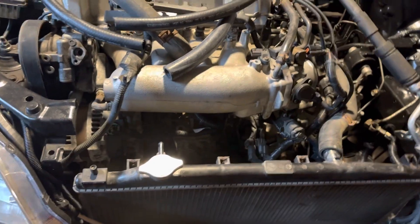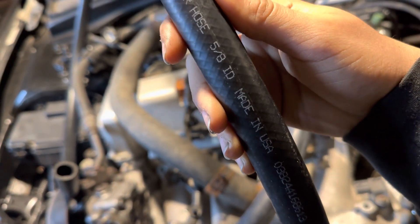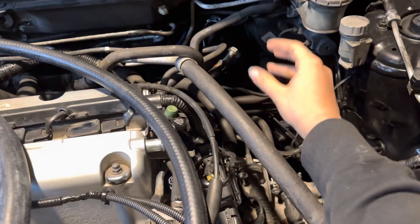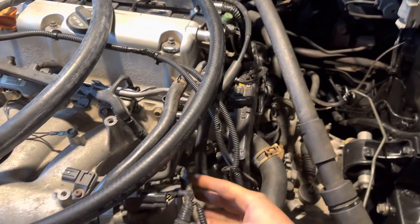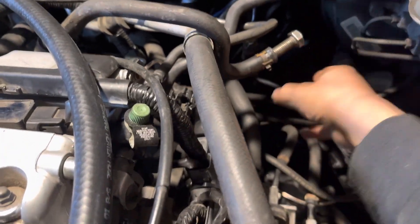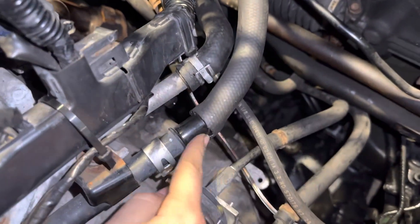Today we're going to try to start the car. Right now I just need to put in a few hoses. I have a power steering one - it also says for heater hose but I'm using a 5/8. Using this 5/8 hose for the power steering pump and it's going to snake all the way through here. I'm going to put my power steering reservoir on this side because there's no room on the other side. I'll test fit the intake first to make sure it won't interfere. Also this very long hose that's supposed to go here - I can cut it basically in half so it'll fit perfectly. I did have to buy a new heater hose - this one is 3/4 - for this one over here, which just does not fit through no matter how hard I try.